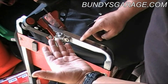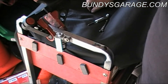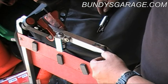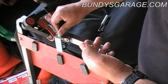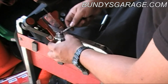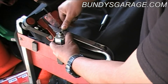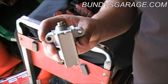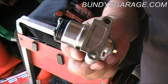Don't get me wrong — there's a lot of tension on here. It kind of dented my bottom finger. But that's how you reset the tensioner. What I'll do is put the O-ring back on, put the 8mm screw back on, and tighten it down. That's how you do that — not hard. If you've got a vise it'd probably be a little bit easier, just as long as you can keep it in place. Make sure that's snug — you don't have to be Superman. Snug it down. The tensioner S is set and ready to be put back on the vehicle.